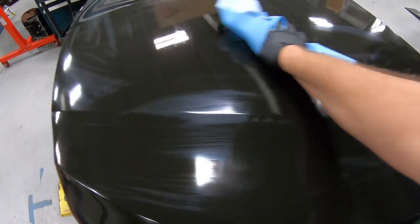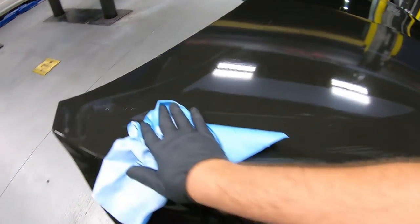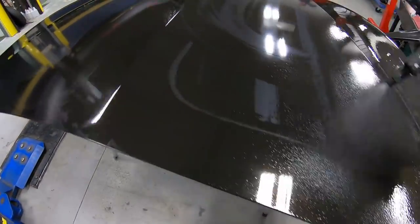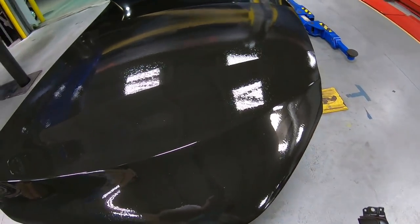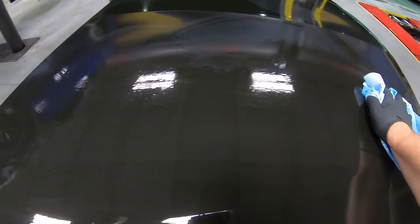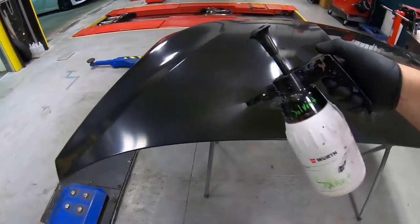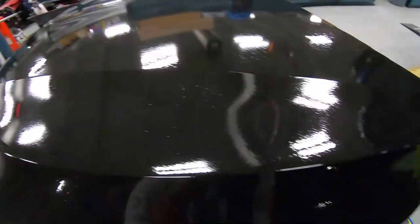So the next one is a solvent-based cleaner, and a solvent-based cleaner is basically going to remove contaminants from oils, grease, and that type of thing. It's a little bit stronger, which I like, because when we're done it leaves a streak-free finish. Now, if you were going to paint the car right now, I would strongly recommend you thoroughly dry each of these cleaners off. But since we're just doing a quick pre-clean, it's not as necessary. We'll perform this same cleaning process on all of our panels to give ourselves a better chance at getting a clean paint job.